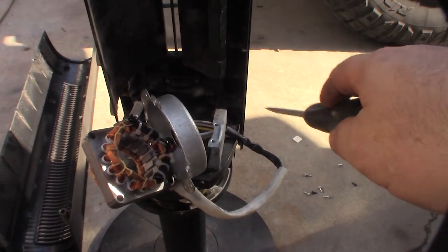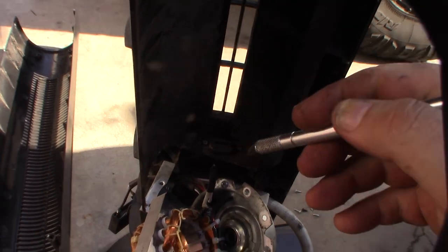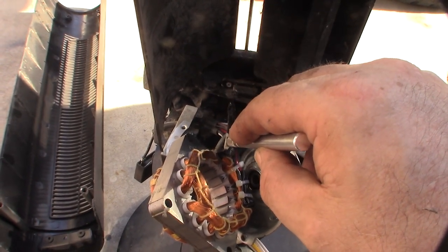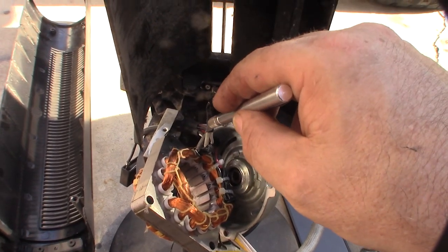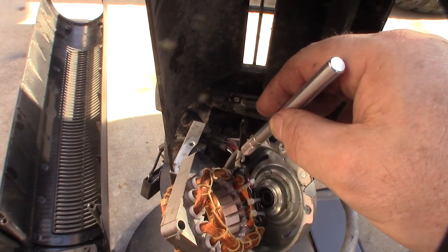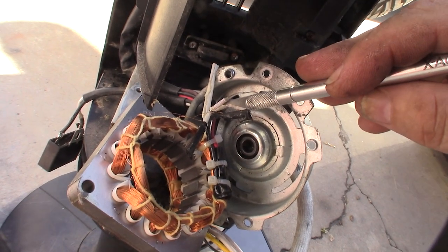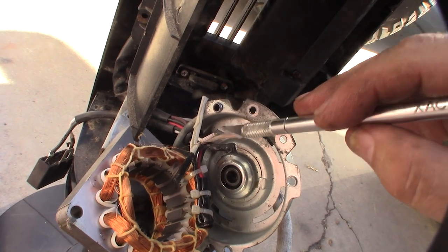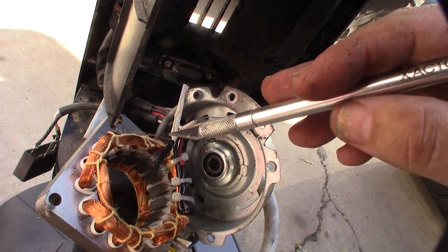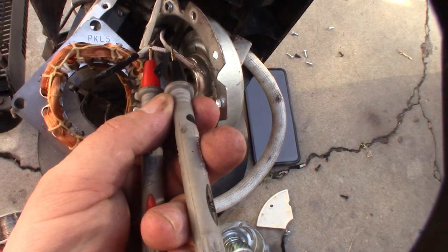There must be some sort of inline protection fuse because it would be unsafe without thermal protection. I feel like there's something with the main power input coming in — inside this little thermal sleeve I think there's a thermal fuse, and that's what would have popped the motor. You have to be careful with these little copper winding things that feed the coils. I'm going to check continuity between the two terminals, and if it's open that's why the motor isn't spinning. Fuse is open — confirmed.